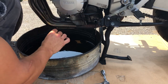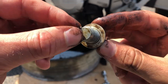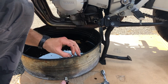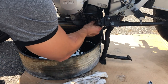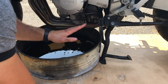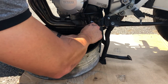Wait for absolutely all of the oil to drain out until it's just barely dripping. Also, be sure to check the washer on your drain bolt — you want to make sure that it looks good and it's not bent or cracked or leaking at all. If you don't see the washer on the drain bolt, check right here and make sure the washer's not stuck, because you absolutely do not want to put two washers on the drain bolt. Now the oil's down to a slow drip, so take your drain bolt, make sure not to cross-thread, and slide that right back on. Make sure it's hand-tight, then take your socket wrench and tighten it down the rest of the way. For the exact torque spec, you can put it down to 31 pound-feet. I just get it really tight and then do another quarter turn and snug it down.